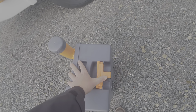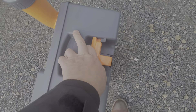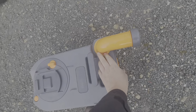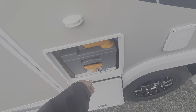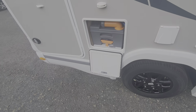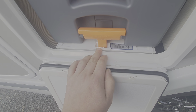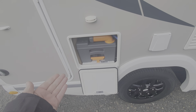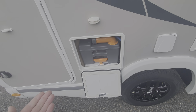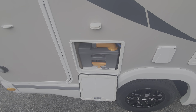Once it's been emptied, to put the cassette back in, click the handle back past its retention clips, put the nozzle back in, and slide it back into its housing. Just ensure the handle is in its retained position. There's a corresponding valve on the inside of the toilet which I'll show you inside — you must make sure that's closed in order to get the cassette out.